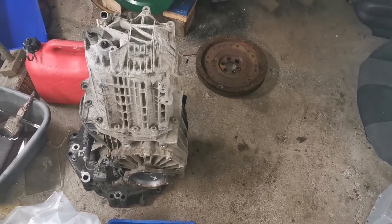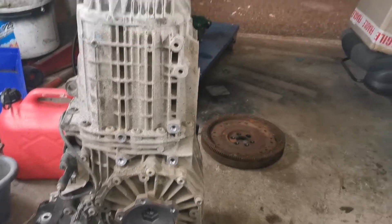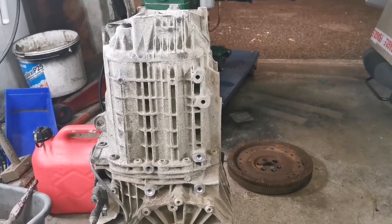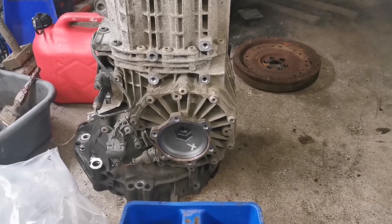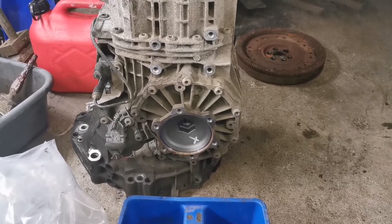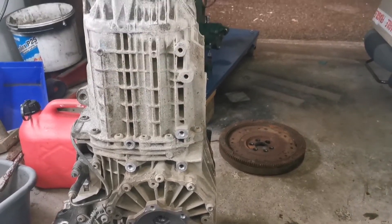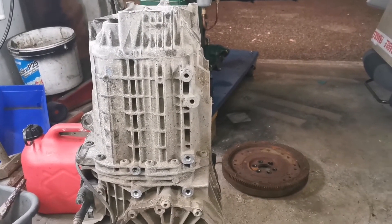The plan with this engine is to get everything assembled on the bench before putting it into the van, which basically means having the engine running on the garage floor with the gearbox attached. There's the gearbox — it's quite a bit bigger than the Beetle gearbox I had out there recently, and that is out of a B5 Passat, 1.9 TDI. What I need to get done is I need to get a 15mm machine from the front face of the bell housing to make room for the spacer that goes onto it. That should be interesting trying to get that done — I'm kind of coming up short on people who actually want to do the job for me so far, but I'm still only at the early stages of searching around.